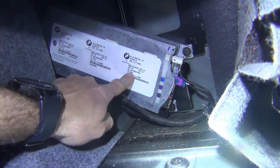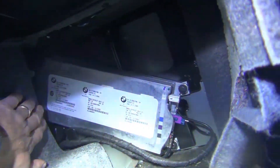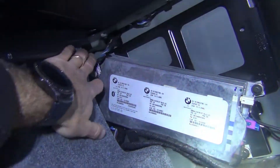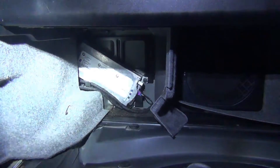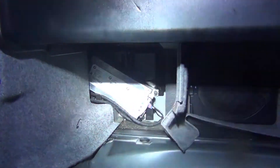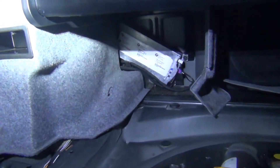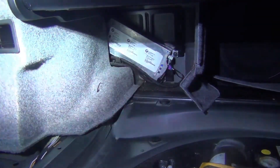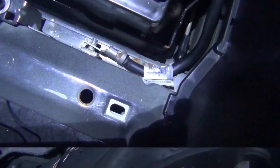Pull this out of the way and there it is right there — that's the telephone communication unit. Here's that pass key I told other people about in a posting: 0761, that's for Bluetooth if the car is equipped, although nowadays with smartphones they're usually not compatible with current smartphones. There's my connector that I've disconnected back there. So this TCU is really obsolete — since it's obsolete, I can go ahead and disconnect it, and that's how I'm going to leave it. That's going to fix the 600 milliamp wake-up this person had. Between the two issues — taking the fuse out for the instrument cluster OBD2 circuit and disconnecting this TCU — I've just saved this person probably close to a thousand, maybe fifteen hundred dollars in component replacements.